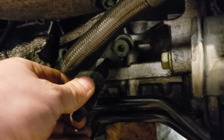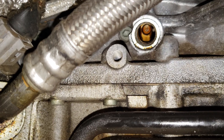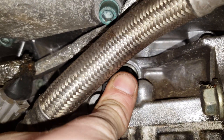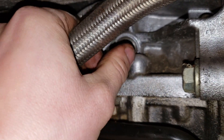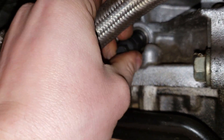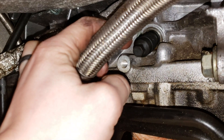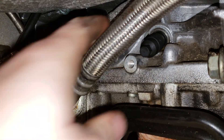To do that, we're going to insert this little crank lock tool inside this little hole right here — it's an eight millimeter allen. You're just going to pop that bolt out and then insert this guy. Now that we have the plug removed, we can see where the little pin is going to sit inside the crank. You can just insert it and it should start to thread in very, very easily until preferably there are no threads left showing.